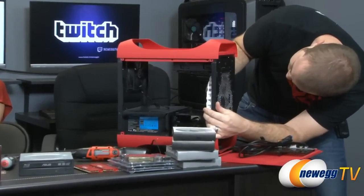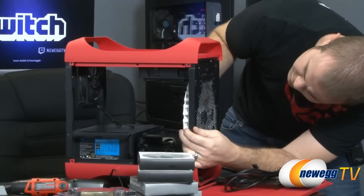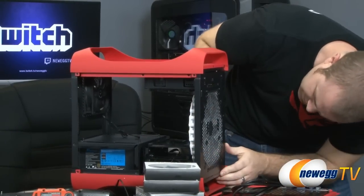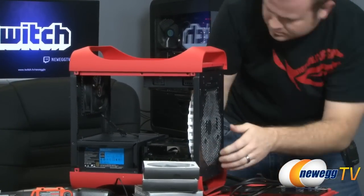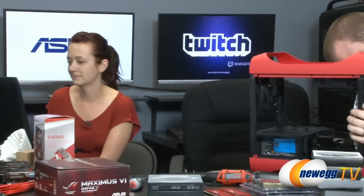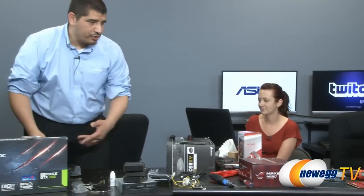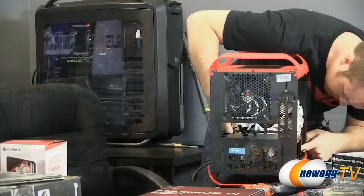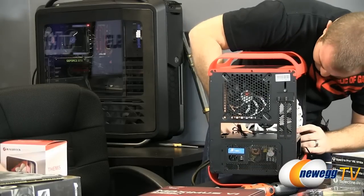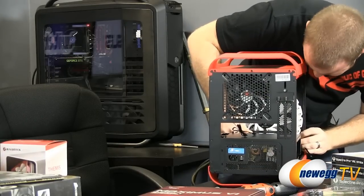As a last thing, if you want to check your hard drive, assuming it's a mechanical drive, you can get different programs. Just search online for something called a SMART monitor, and it can help you to check the SMART data on your hard drive, which is like a pacemaker for your hard drive, and it'll give you information about the temperature, the reliability of operation, how many errors are being recovered on your drive, things like that. So if your drive is on its way to failing, you might be able to preemptively find that out.